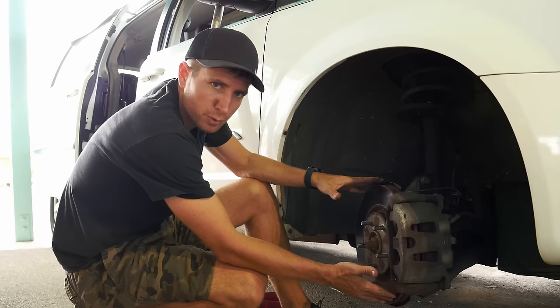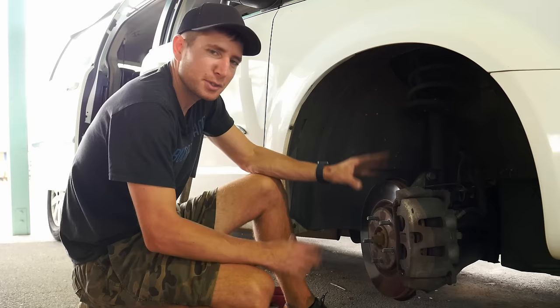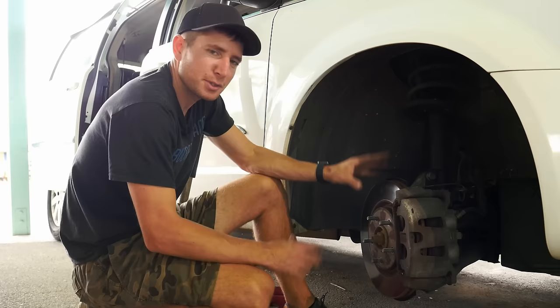When it comes to rotors and you take your car to a shop, they're going to recommend new rotors too. The reality is, as long as the surface where the brake pad is rubbing is in good shape — meaning no big rough edges, no rusty pitting, no big lips at the top or bottom — it's probably good to keep using the same rotor. As a disclaimer, brake wear numbers are really dependent on a lot of variables: where you drive, if you're going up and down hills, and whether you have high-quality pads versus cheap ones. It's really important that you inspect your own brakes and are familiar with how fast they're wearing out. Ultimately the choice comes down to heat.